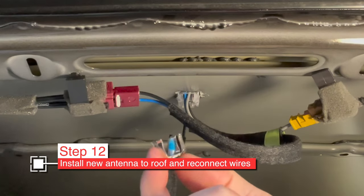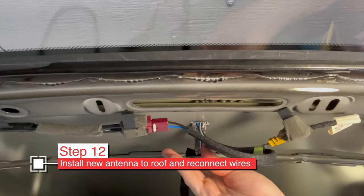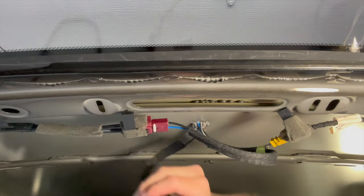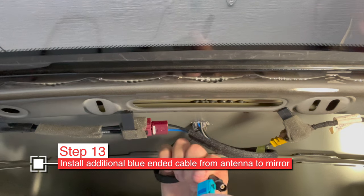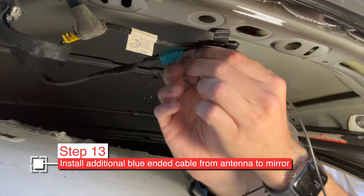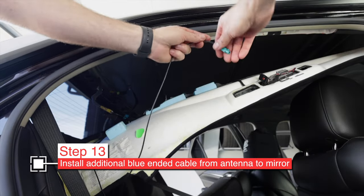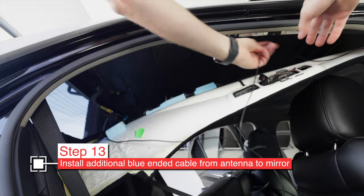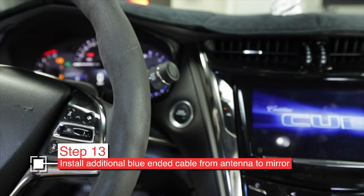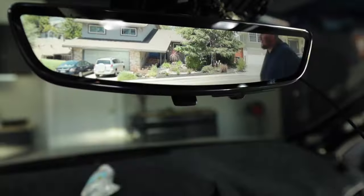Clean off the roof where the antenna mounts using isopropyl alcohol, then run the wires of the new antenna down through the hole. Plug in the power connector and re-clip it to the roof. Plug in the XM antenna plug and connect that to the roof as well, along with a clip a little closer to the door. Install the 10mm bolt and metal mounting piece — make sure it's nice and tight so the seal on the bottom of the antenna seals against the roof, but don't compress the roof. The new connector on the antenna connects to the cable with the blue ends from the kit. Plug that in, tie up the wires, and route toward the front. Then plug the other end of the cable into the mirror and start the car to test — flip the tab to switch from reflection to the live camera view. It is awesome.